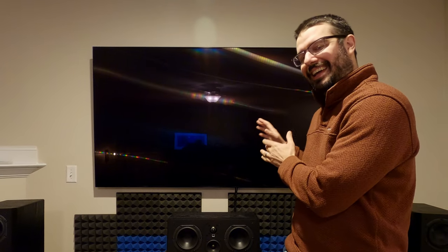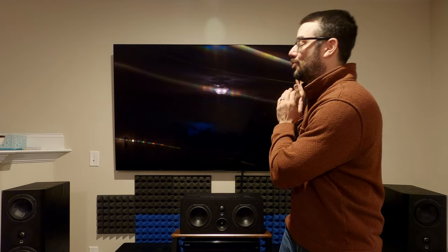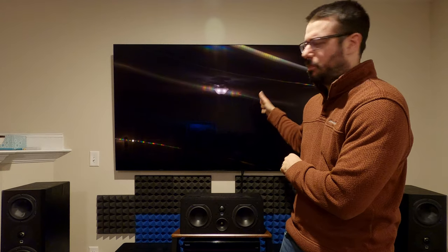It is Steady Chaos, and I've been wanting to make a video about the QN90A's mini LED backlight system and what exactly I think about it. The black level performance on this TV for an LED LCD is insane. It's extremely good. The 65 inch variant has about 700 to 800 dimming zones, and the 75 inch model like this is around 1000 dimming zones. So that's pretty good light control.